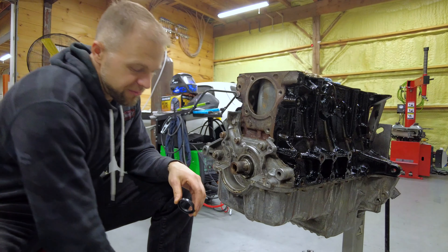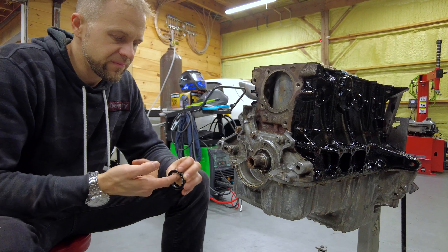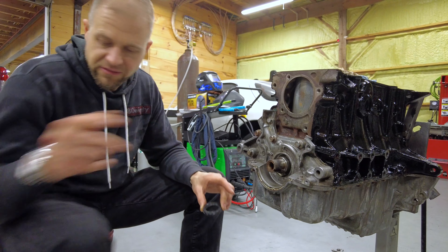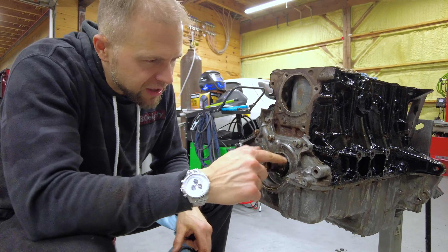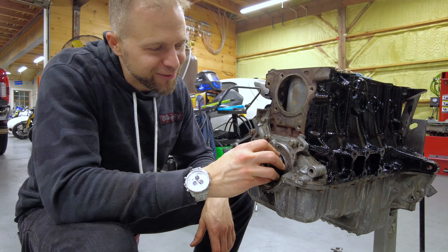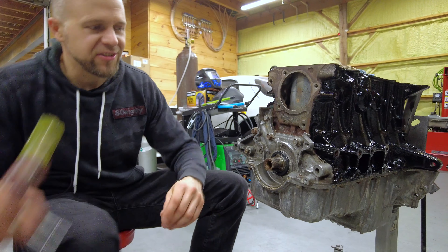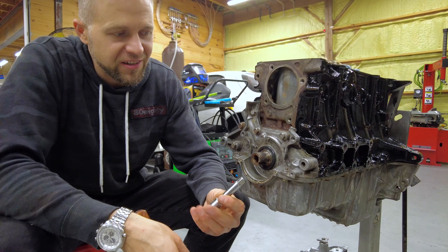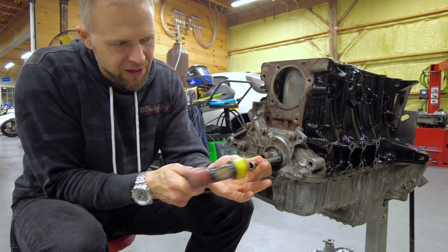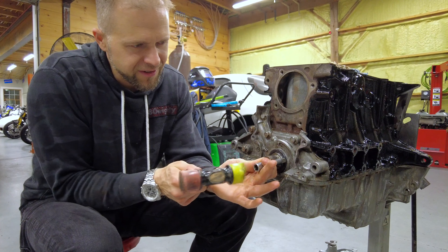We should put some anti-seize on that. I don't have a puller with teeth that small, so I really don't know what I would have done without damaging it. I was surprised — I got mine off without a problem, put it right back on. Matt, your car's very well-miled. I think you could just use a screwdriver if you can hammer it in, but you do take off a little bit of the aluminum. I forgive you because you're my brother and I love you. I'm going to use a 3/8 drive socket extension — don't want to go too much on one side, just start where it's sticking up the most and go the opposite, a little bit at a time. Just like I did the cam seals in our last video.